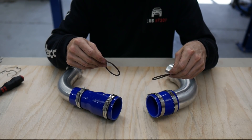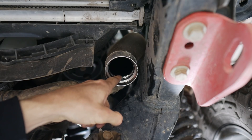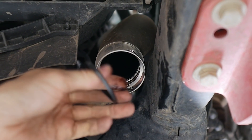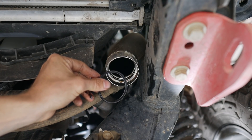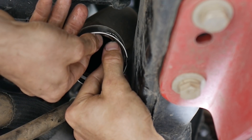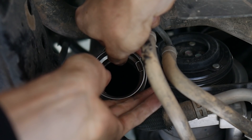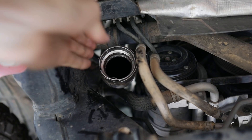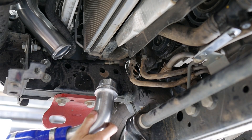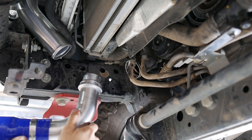Let's get these seals in place of the OEM seals. Inside the pipe there's a lip seal — it's the same on both sides. Get a flat blade screwdriver underneath it, lift it up and hook it out. Now replace it with the one CRG has supplied. This is the cold side, so it will be the bigger of the brown O-rings. Put some rubber grease on it and pop it into exactly the same groove you removed the factory one from. It's awesome that Chris has supplied these seals to replace the OEM ones because they do have oil leaking issues from factory — these are an upgrade thrown in as part of the kit. Do the same thing on the hot pipe side, replace the O-ring seal, replace the clips, and put some rubber grease on the end to help with installation into the OEM pipe as it can be a little bit tricky.